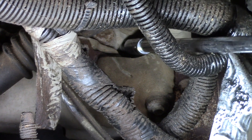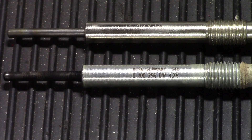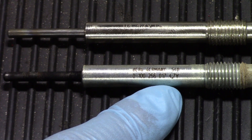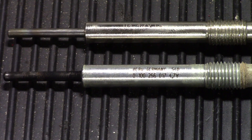In our case it broke free pretty easily and it's already turning out as you can see. Now that we have the old glow plug out we can verify we have the correct replacement by putting them side by side and matching them up. We've verified they are the same length and have the same thread count. One of the most important things is making sure the voltage rating is correct — the old unit is 4.7 volts rated and the new one is also 4.7 volts rated. There is a 12 volt system and a 4.7 volt system, so make sure you have the correct glow plug.